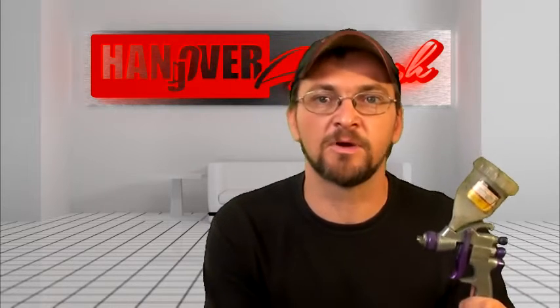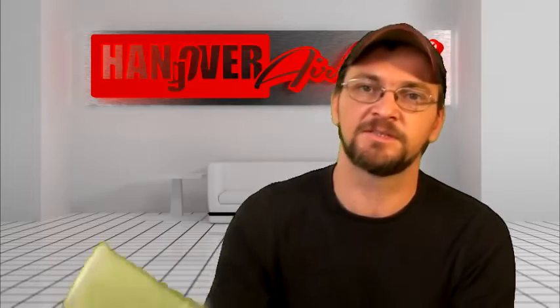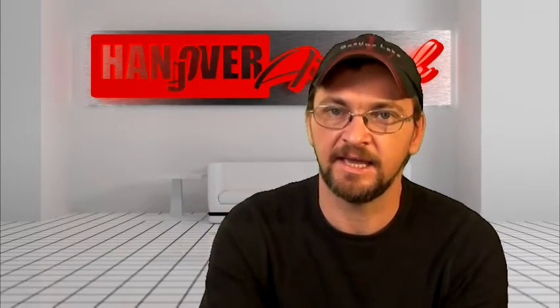The little pancake compressor in my setup, which is my daily driver — that's what I use all the time — and it's actually big enough to where I can use this mini HVLP touch-up gun and shoot clear through it. When my work is finished, I usually use a two-part 2K urethane clear, and this is the old Harbor Freight. I've actually gotten pretty decent results from it.